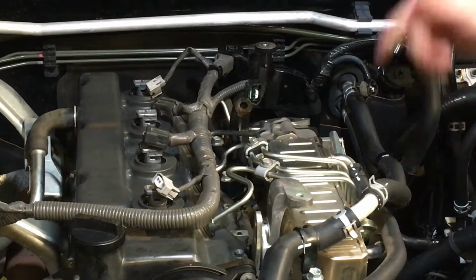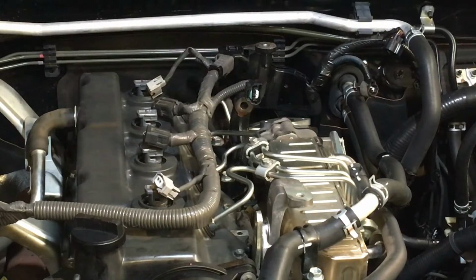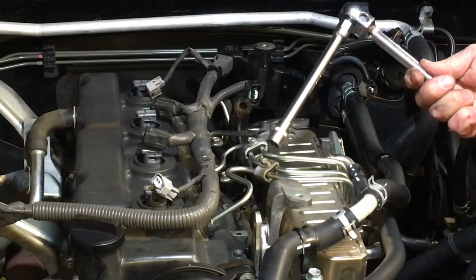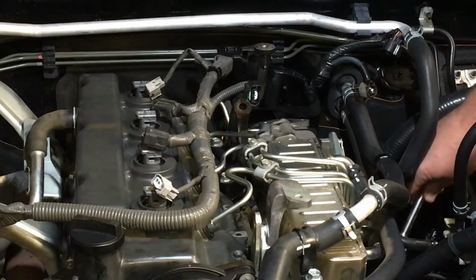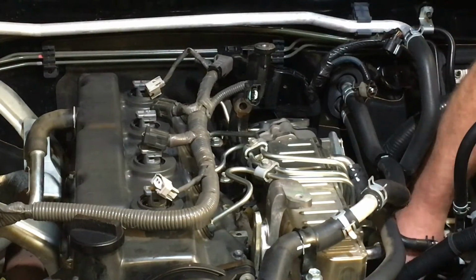Now, the bolt at the bottom of that stay. So we need to get our 3/8 drive, our favourite extension again, and our 12mm single hex. Well, we showed you in a bit more detail on the taking it out video. This is what we use to do it up. Put it on doing up. Our arm goes down, in through this gap near the firewall, swing it around.